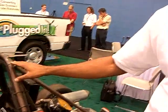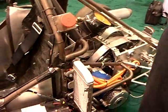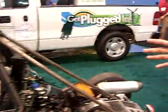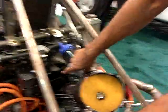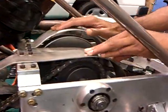We've participated in both, and at this year's competition, this was our entry that came in third — something we're really proud of. To give you a brief overview of the hybrid drivetrain, what we've done is we've taken a 250cc Yamaha engine and we've also added a DC electric motor. These two are connected to each other through this torque coupler here, which has two CVTs.